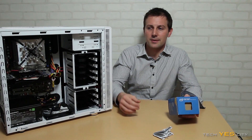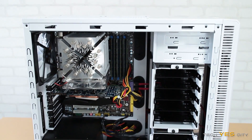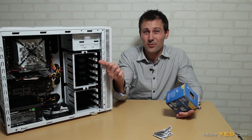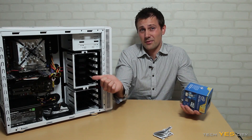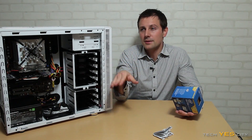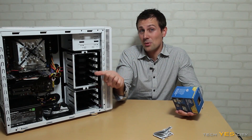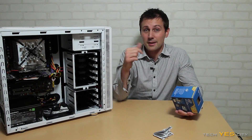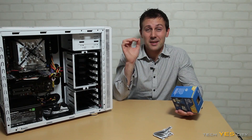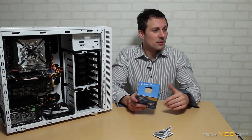All in all it was a great experience — this is going to be a fantastic workstation, especially since it beats the 1231 V3, which I think is the fairer comparison. One thing to keep in mind when buying used is that this is a 4-year-old motherboard; who knows how much life it has left. The X5650s are often pulled from servers where they've been babied, so the CPUs aren't a big concern — it's really the motherboards. SATA2 was also limiting the SSD scores in the AS SSD benchmark.